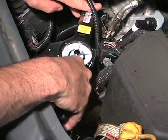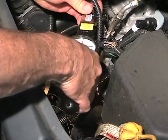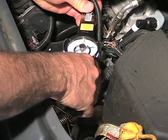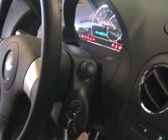In this installation, we're using a torque wrench and tightening the cap to 25 Newton meters as indicated on the cap. Do not over-tighten the cap, or damage to the cap or the housing could occur. This concludes the filter installation procedure.